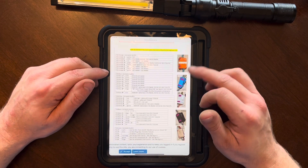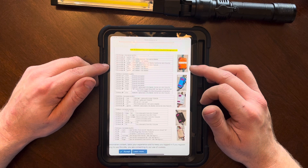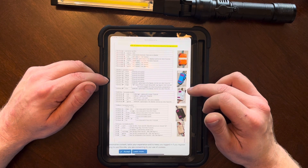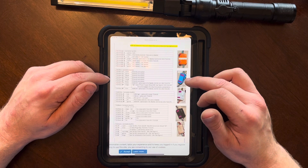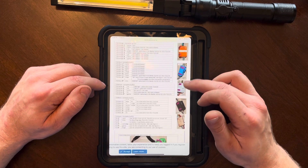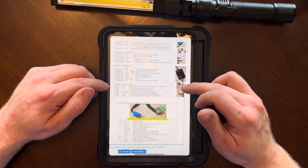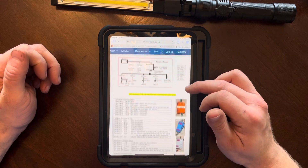Coming down - one of these connectors that I cut out is actually your throttle pedal. There's a blue wire there, so if you do cut that wire, you've got to check your wiring colors like I showed on the paper. Make sure you wire that up correctly. If you wire it up correctly, it will run - you don't have to have that original plug of course.